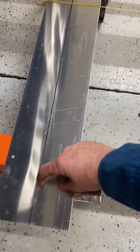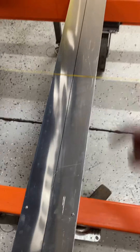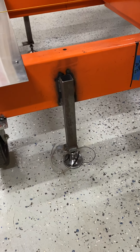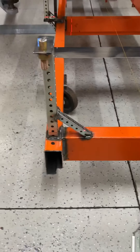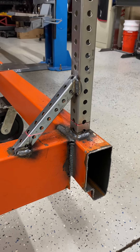With that, it's a matter of getting a level off of the bottom of your rockers. I also put a perpendicular line to the centerline, which is this line here. I just clamp a straight edge across the face of this line, drop my tape measure on the front edge of that — that's my perpendicular line — and I can measure back to my perches to verify those are all square and true to the body. I bought some casters and had some leveling feet laying around, welded some tubes onto the side, and that gets me level. I can pick this up, move it around, and then it's just a matter of setting up my laser again and jacking up my jack screws until my laser picks up all of my lines and all my tubes again.